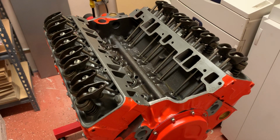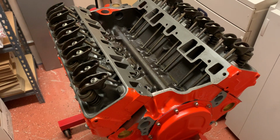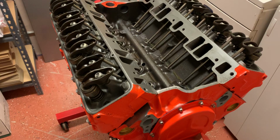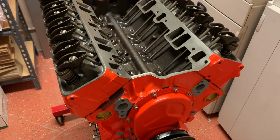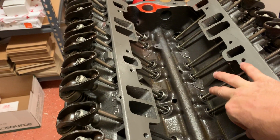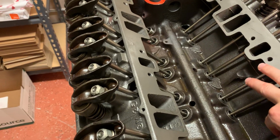And then I put a drop of oil underneath the head of the bolt, so when it hit the head, there would be a nice smooth torque down onto the head rather than metal to metal friction. Then I threw my rockers in and my push rods. I tightened my bolts right down to the top of the studs, but I did not do any adjustments yet.